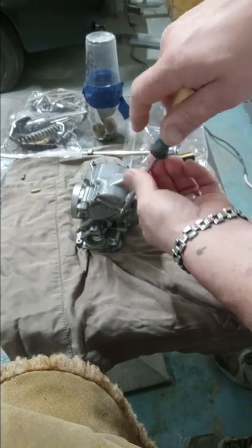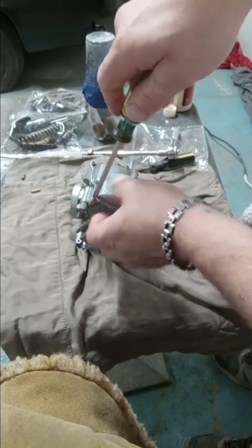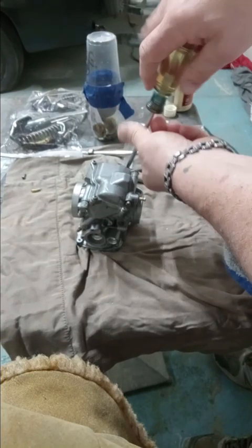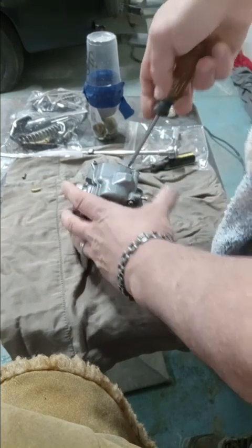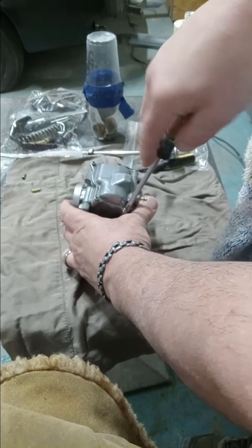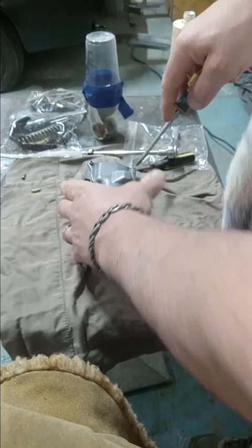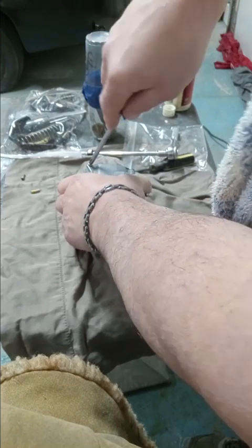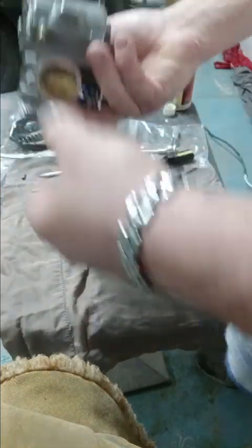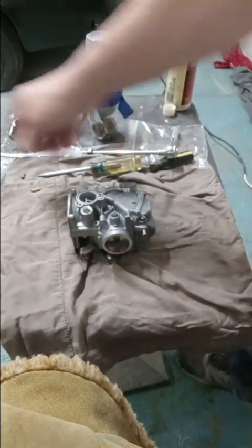We're doing an X-pattern here with these four screws — just snug them. With a new gasket in there it's really going to be nice. I kept smelling gas and noticed the carburetor was wet around it, so I took it apart. The next day it didn't want to start, and it turned out that was the jet — it had backed out. All right, that's it — the float's functioning still. On to the next process.